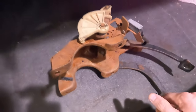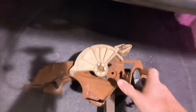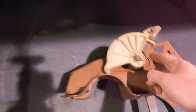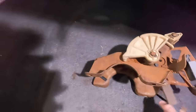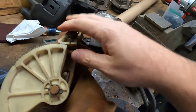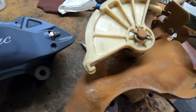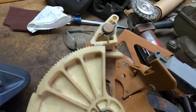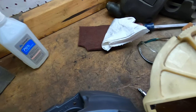We had to replace it. I don't even remember where I purchased this pedal assembly to be perfectly honest. You can see here is a factory pedal assembly with the quadrant. On this car, the cable literally has an arm and the cable connects directly to the arm. There is no quadrant. There's no wrapping around here. The cable basically rolls around the top, clips into that groove right there, and as the clutch pedal is depressed it pulls on the cable and disengages the clutch. This will adjust as needed to make room for wear and tear.